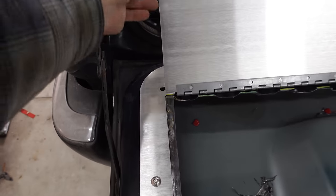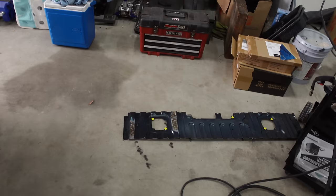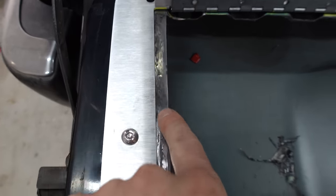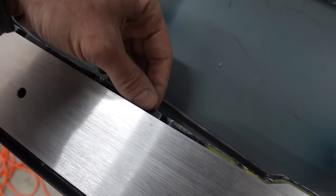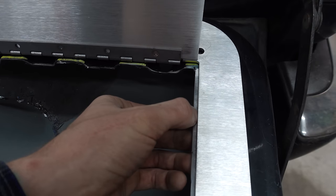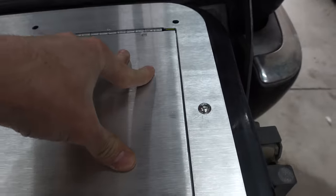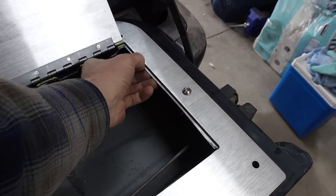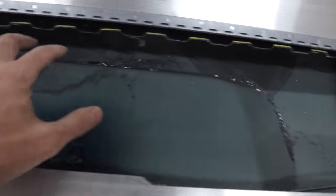Let me turn the camera around and show you what I'm talking about. When the hatch closes, it needs somewhere for the lid to go. This is the part I just welded back on — luckily I kept the panel that I removed. You can see when it closes it'll lay down on the existing tailgate metal. It's fine at the top where I have about a quarter inch, but the passenger side is probably only an eighth or three sixteenths.